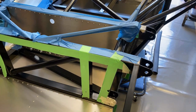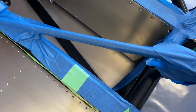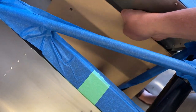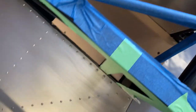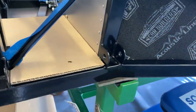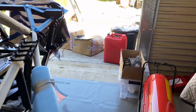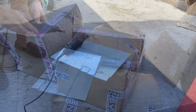While I'm here, I need to cut in the battery tray — it sits on the right hand side here. I've made up a bit of a template to reduce the number of times I have to get it in and out. I've got to cut it in between the front supports and get it all to fit in there. I've marked it up on the actual battery tray itself and we're just going to use the Dremel to cut it out.